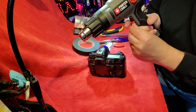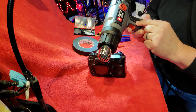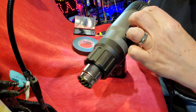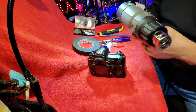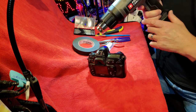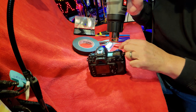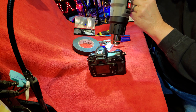Let's put it on. It only has high and low fan, so we'll put it on the low fan and set the temperature. That would be the hottest setting — I'm going to go at about 60%. You may not be able to hear me too well because of the heat gun. What this is doing is loosening the glue that's holding in the original glass — it's just double-sided tape. Let's go on the high power, the high fan.